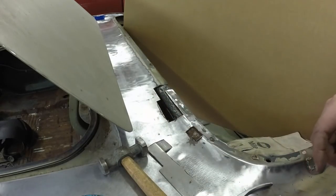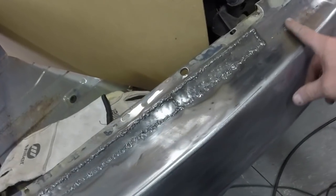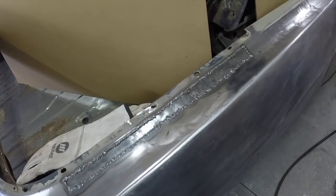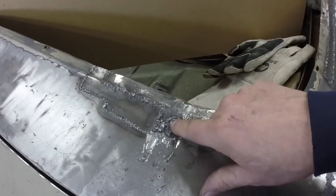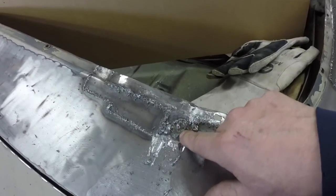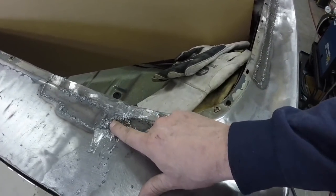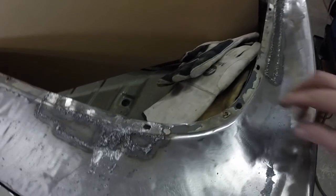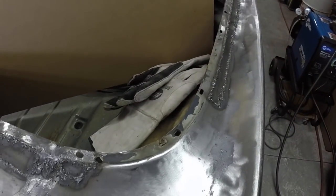Perfect. Time to tack that one in and weld it in. This one's just a rough weld — I've got a finished grind still to do; it's still got slag and stuff. I'll scrape it and grind it out and put a coat of filler on it before the day is out. That's where that hinge is spot-welded. I cleaned the lead out of there, could see where it was welded, and just ran my weld around there to make sure there's no future rust there. I corrected it now and I'm going to take my angle grinder and clean all the welds up.